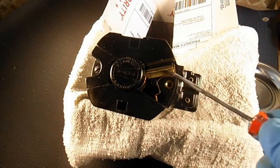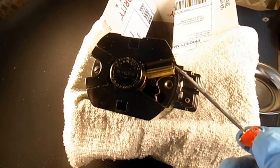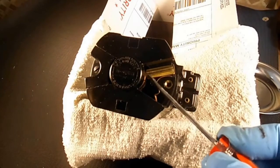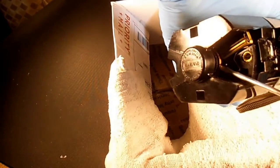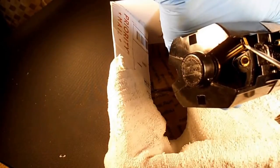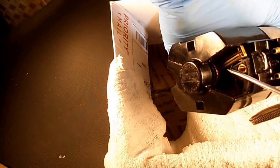This is the brush holder — it's like a square brass tube with a little fold-over closure on the end, and you can see the brush spring inside. Down here between the brush holder and the copper commutator is the carbon brush. The brush holder holds the carbon brush under pressure with the spring and pushes it against the commutator, so the brush rides along on the commutator.